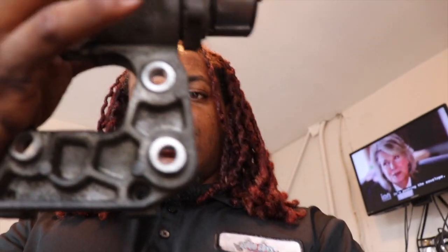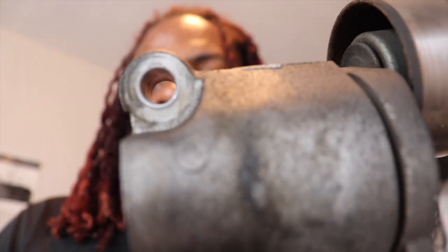I'm going to grab the old one to show you guys how it looks so you know where the five screws are. Here's the old one — five screws, it sits like this. There's one, two, three, four, and five at the top. That top screw is exactly the reason you have to take out — or at least move — the alternator out of the way; otherwise you'll be fighting with yourself all day for no reason.